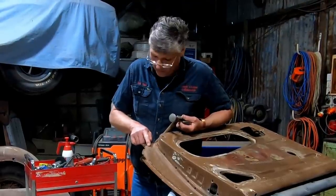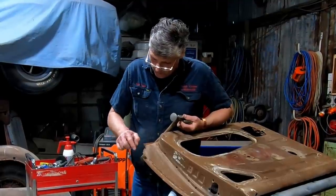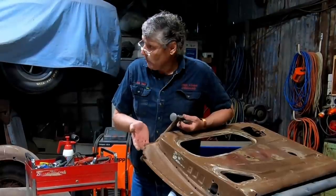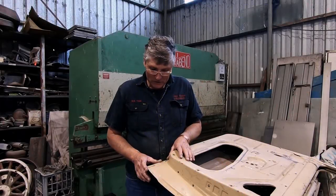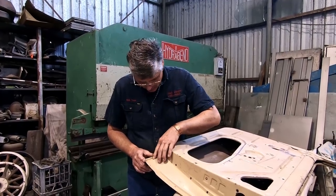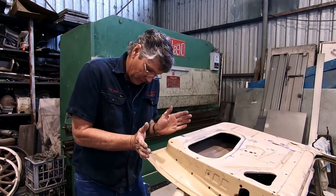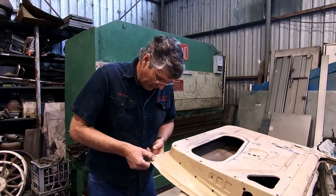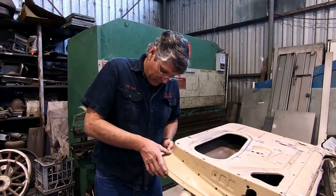Putting the weld through this area here, where it runs in from the high point on the frame down to that point there, you'd make a piece that comes in from this side and picks up that edge — make a little piece in there. But we'll make a one-piece patch for the corner and talk about that as we go. This is the shape we want to achieve — this is our good door that I'm going to use on the other car. It's really quite a sharp corner in here. This actually comes up almost square shape, a little bit past 90 degrees, and then we've got this big flat area down the back and a big flat area under there.